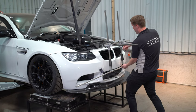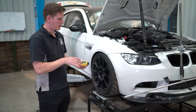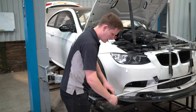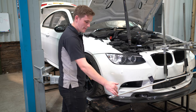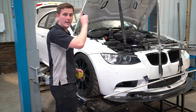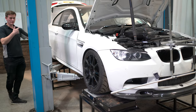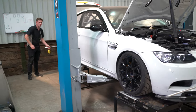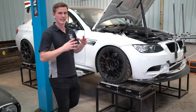With the rig mounted front and rear, we put the strings on and run them front to rear. The BG Racing kit comes with string reels — take the looped end, slide it over the end of the pole, and place it into one of the machined grooves. On this car we're going to use machined groove number three from the outboard, and we must use the same groove at every corner of the car so it's the same distance from the center line at each corner. Run the string down the side of the car all the way to the rear pole and into groove three on both sides. The next step is to take measurements to calibrate the kit to the car.